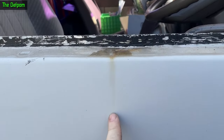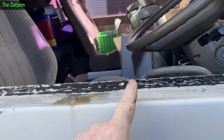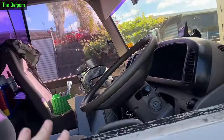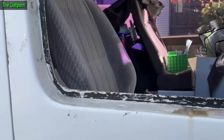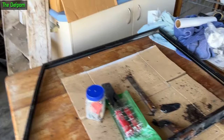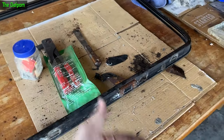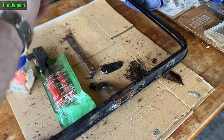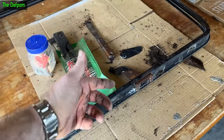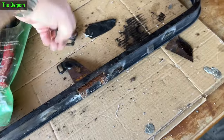You can see the rust mark here - we've had an issue with rusting. It's not actually on the body of the door, it's on the bracket. I knew about it being an issue, which is one of the reasons I wanted to fix this. It all comes out glued in - exactly the same setup. Four clips hold it in and then it's glued, just like all the other windows. Here's the window, already stripped down. A couple of screws at the bottom, screw at the top, take the divider out, pull the glass out, pull the other glass out - done. Now this bracket, which is the rusty one - this is actually riveted into the frame.